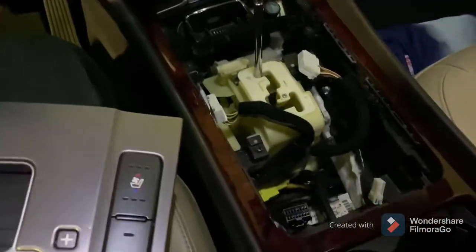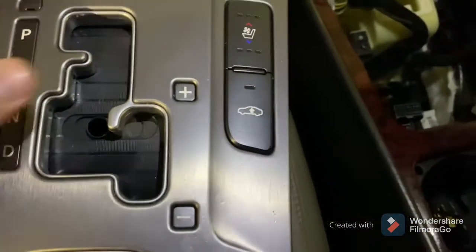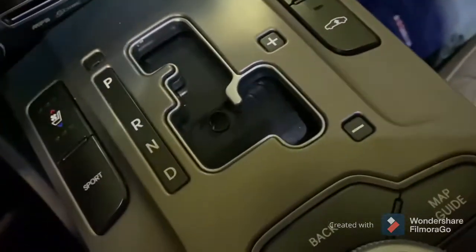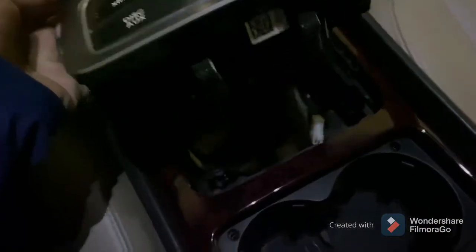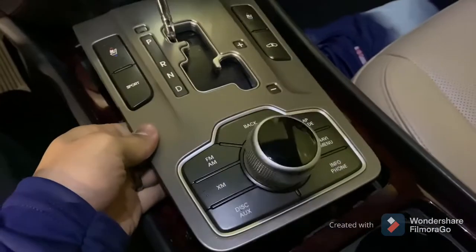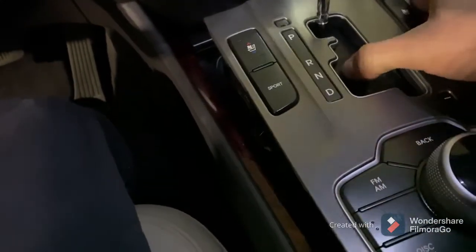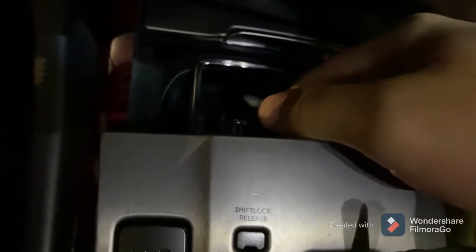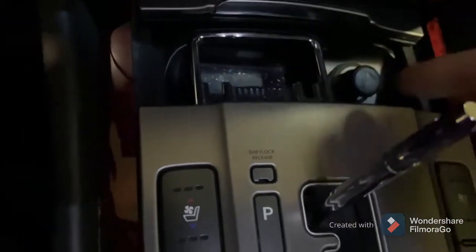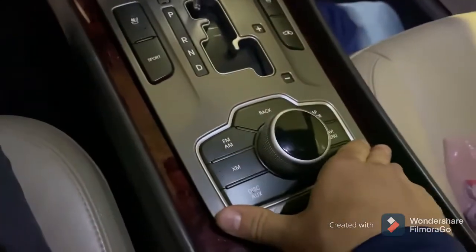We're back on the car — we're going to reinstall this. Basically you're just going to line up the hole in the shift cover with the shifter, like that. Lay it down in position and reconnect your four connectors. Everything's plugged in. I'm going to realign this — make sure this is not sticking out; we need to make sure this is all the way in. We need to slide this back — it goes down underneath this whole piece, so just kind of bend it and force it down. There's kind of a ramp in there that it'll go on to, and then basically you're just going to press it back in.